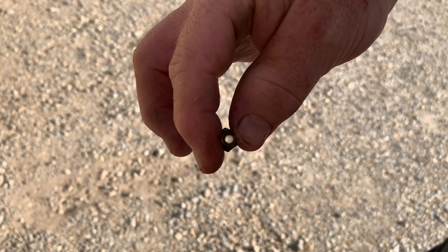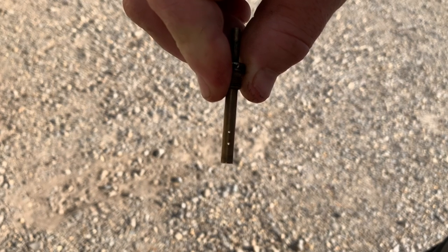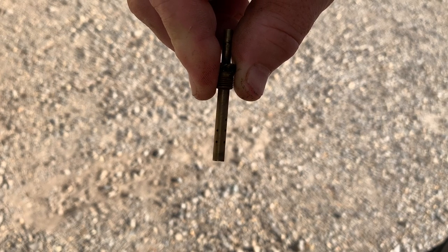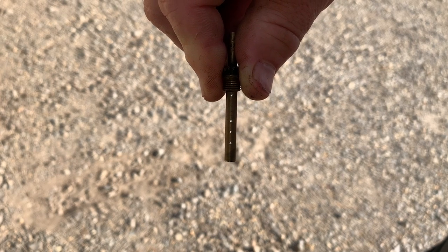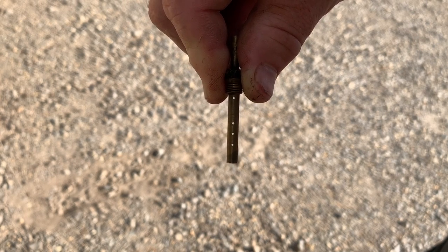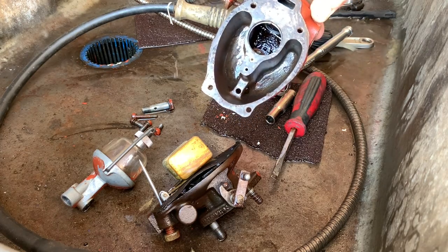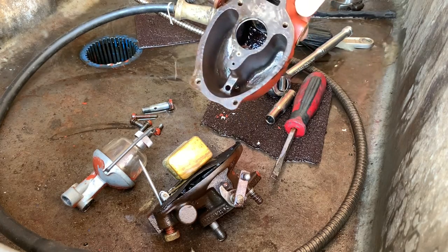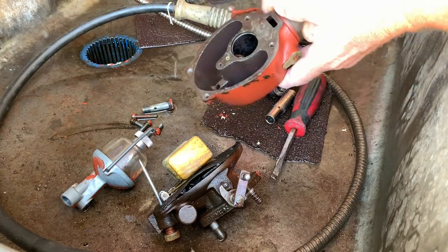You can see it's cleaned in that direction, but we're going to clean it again. Now you can see through those two on that side — this side has four — and now you can see through those, so that one is clean. You want to make sure the float bowl is clean, because you may have heard it called a sediment bowl. The reason it's called a sediment bowl is that solids collect in there and can get sucked up into your jets.